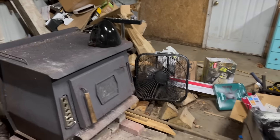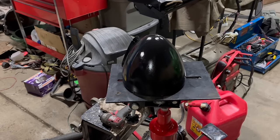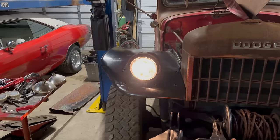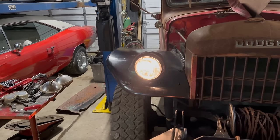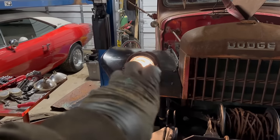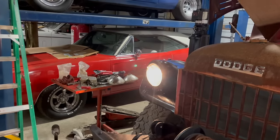It is cold. Did you guys know hot things are really hot? It's a headlight — but does it work? Initially the answer was no, but only because I used the factory chassis ground wires for the headlights and that headlight bucket was loose. As I tightened it, it started glowing brighter and brighter, and now it looks great. Not bad. High beam too.